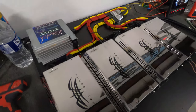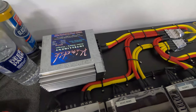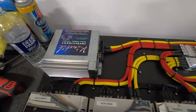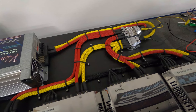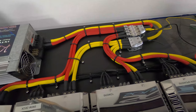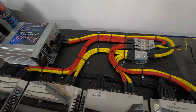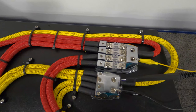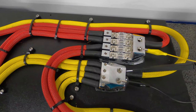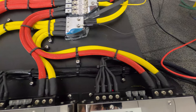So here's what we got. We have the amp board all wired up. This is a power supply that goes on here — that's how we'll DD1 these amps and set all the gains. The red and yellow cabling is ABYC compliant: on a boat, yellow is our ground cabling and red is our power. This is all of our fuse distribution for the amplifiers, as well as where the power supply comes in. This is our ground block that distributes everything, and all of our speakers are connected here.